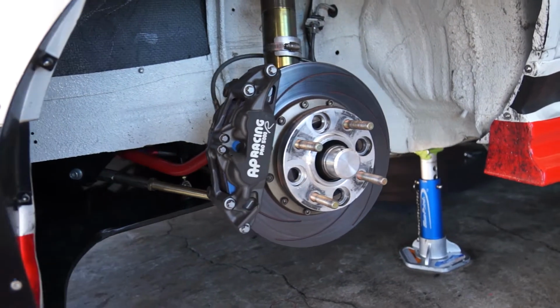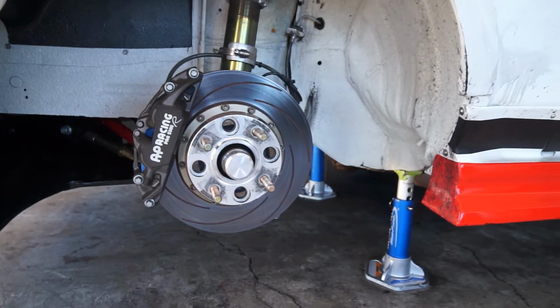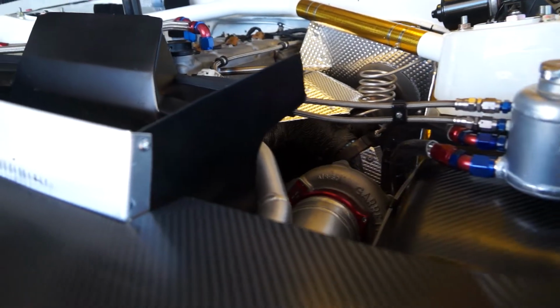All right, the sensors, as I mentioned before briefly, we've got the steering wheel sensor. But as far as engine sensors go, we've got a few combined pressure temp sensors in all your usual places. We've got coolant, oil, and fuel. Again, packaging: it's easy to mount one sensor as opposed to 2. It's easy to wire one sensor. It cleans it up in that aspect. We also use a pressure sensor supplied by Bosch for the exhaust manifold pressure. It keeps the turbo where we need it to be, and we're not exceeding and jamming excess boost in there when it can't be used.